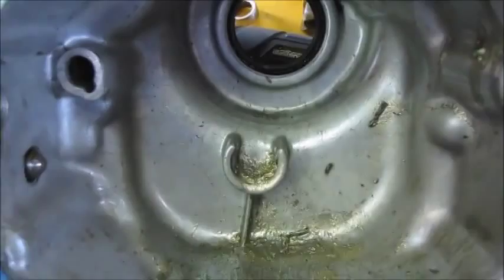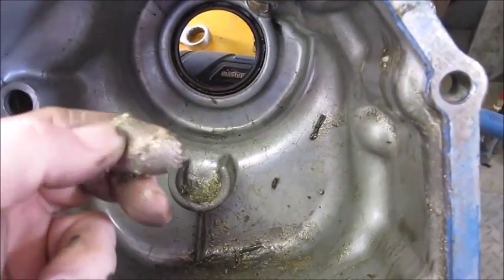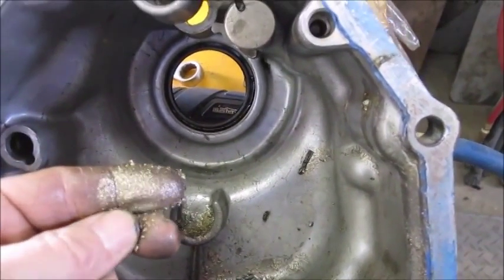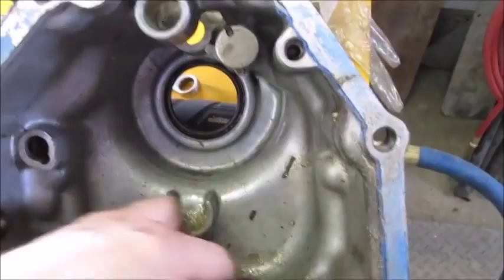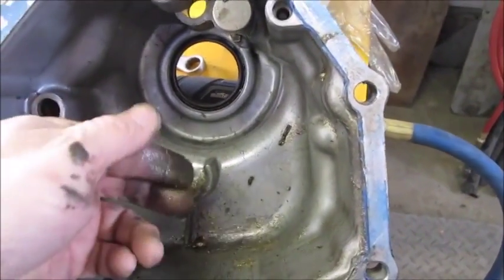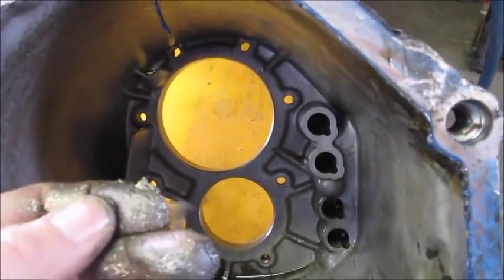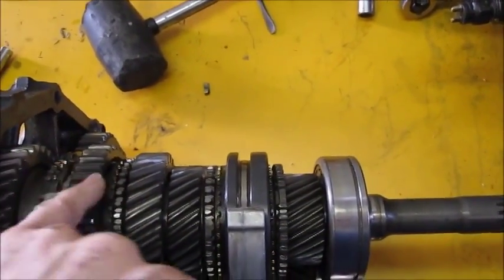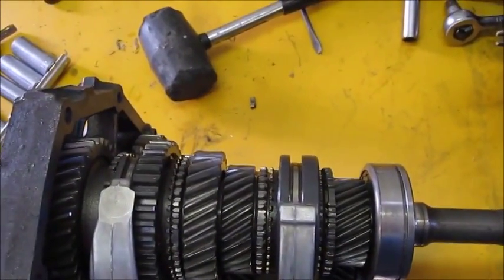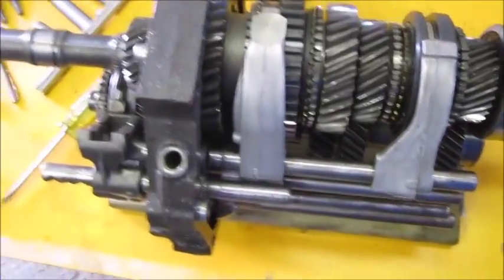When I take a look at the original front cover, there is a great deal of brass filings here. This tells me that the synchromesh rings were really starting to wear out and it was definitely time to replace them. Even looking in the bottom of the case, there is all kinds of crud and pieces of metal mixed in. This transmission was definitely ready for a rebuild, and based on the damage to that first-second gear synchromesh ring, it was taking a beating. This will be a great transmission to use for parts to repair the other one.